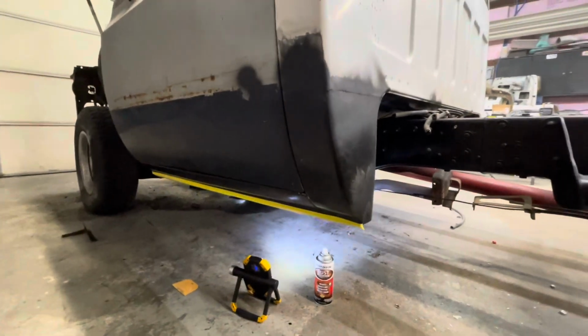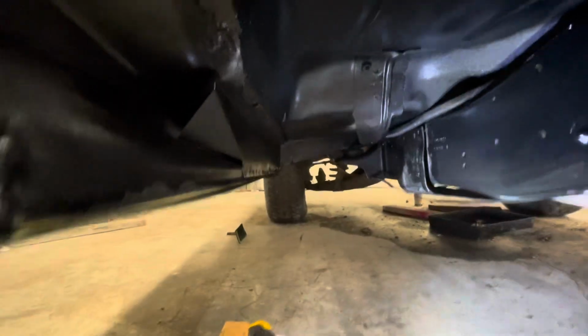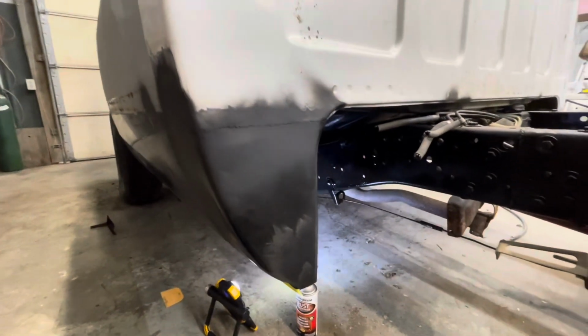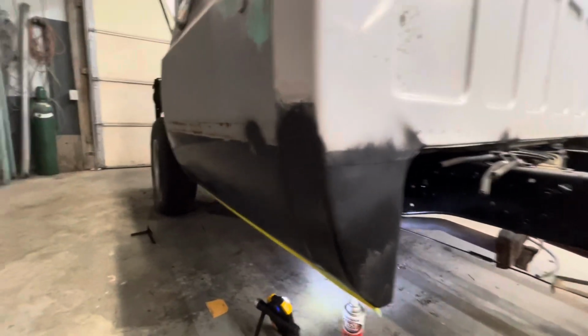All right, I got the cab corner put in, the rockers put in, everything's lined up good, gaps look good. Just got through putting some bed liner on the inside. That's what I'm using underneath the cab. Got the frame sprayed where the tank goes, so I've got that ready to mount the gas tank back in. So that'll be my next video you see. I'll have that put back in, get the lines hooked back up and get it where I can move it in and out of the shop again. And call it a wrap this week.